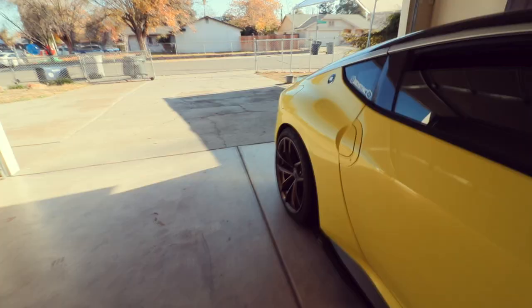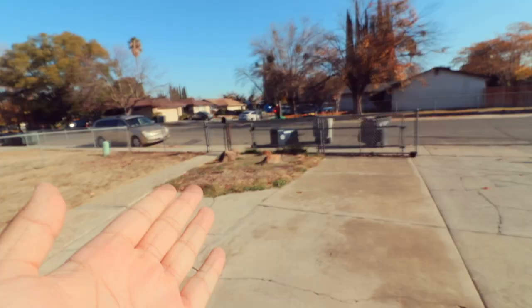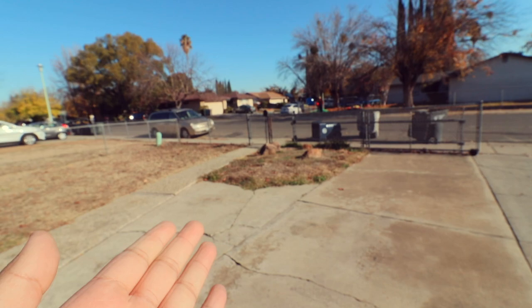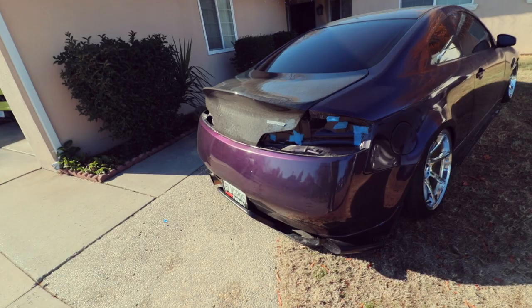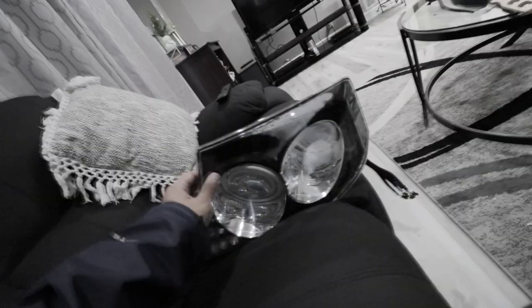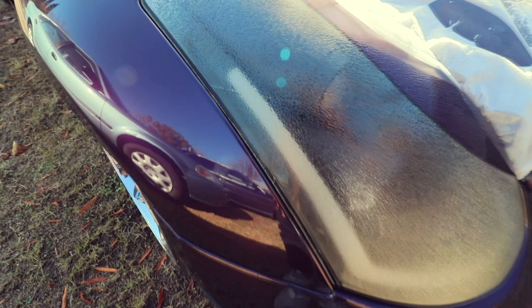So recently here in Sacramento the temperature has dropped significantly — it is not winter, but it went from having 110-degree days to having 40-degree days, almost 35 degrees some days. As you can see, our taillights are currently off because one day I was gonna ride in my G35 and I noticed there was some fogging going on inside my taillight. I've experienced this before on my headlights, but I took them off, resealed them with silicone, and haven't had that issue since.